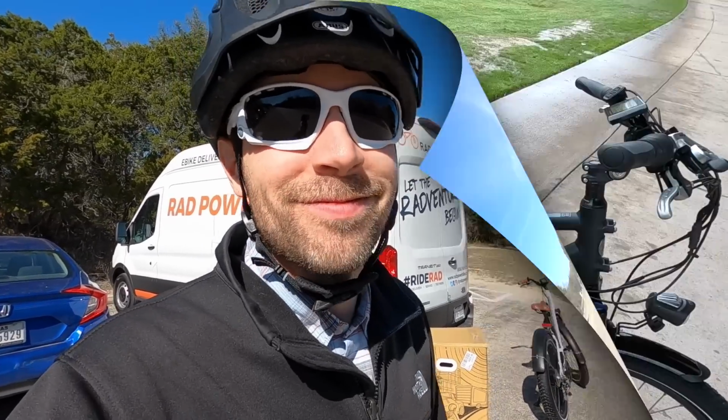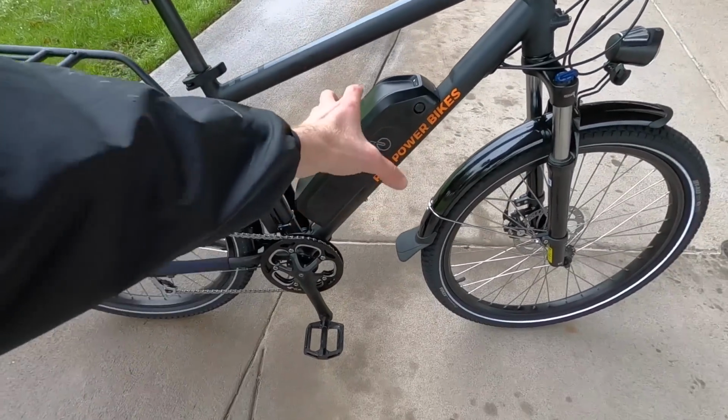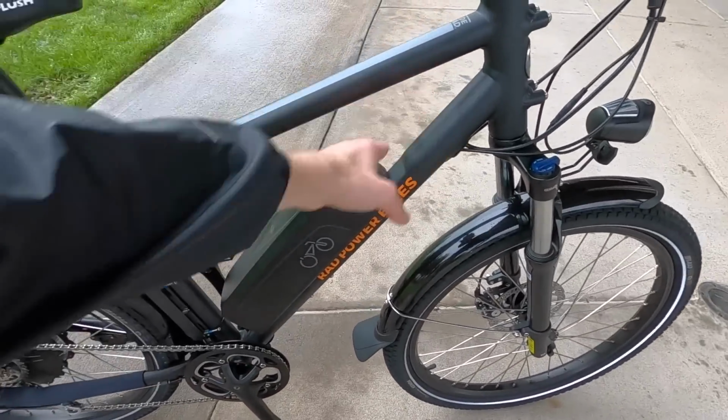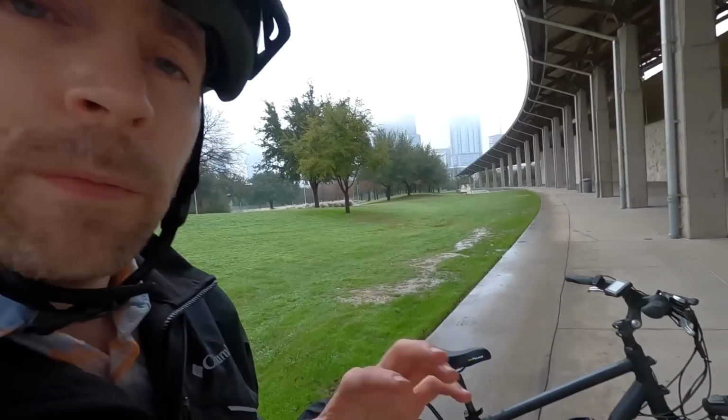I think that's awesome. There's a lot to be said about these bikes, and this battery weighs about 7.7 pounds. You could take that off the frame and hang it on a car rack, and then you could charge the battery separately away from the extreme heat and extreme cold. That's my advice. They use higher quality Samsung 3500 milliamp cells, but the extreme heat's still going to reduce the number of full charge cycles you can get.